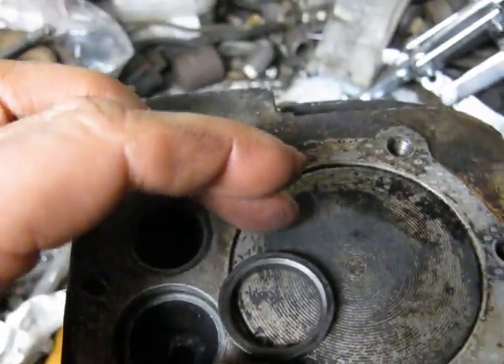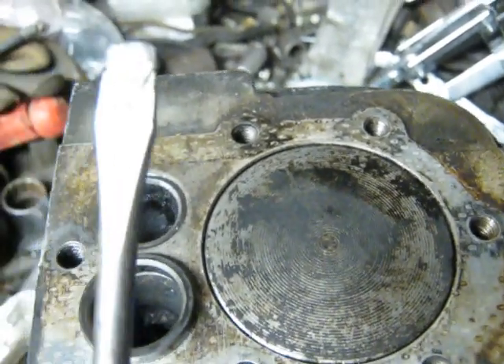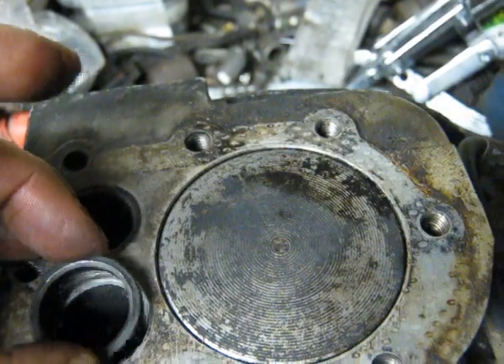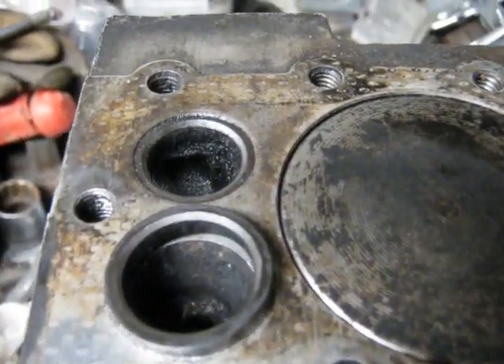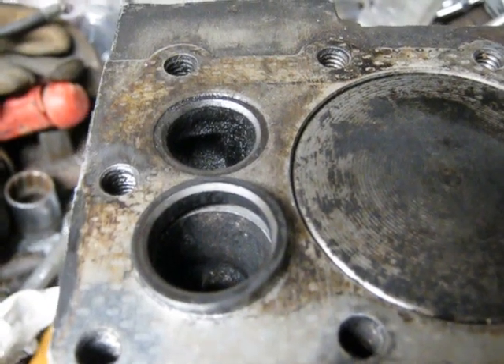I have one block that did that. So I got a flat blade screwdriver out and was able to pry the seat out. Now I'm going to put a little bit of JB Weld in there and put it back in and stake it in place — I'll show you how I do my seat repair, and hopefully it'll work.